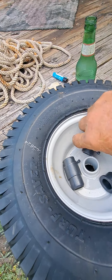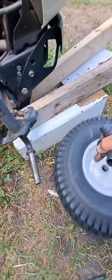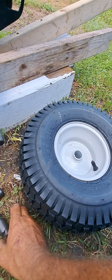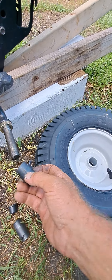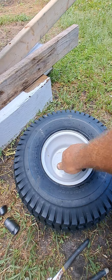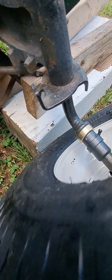Now we go with our spacer. I don't know which one of these is the right insert. Might as well grab the tire while we're at it. First your spacer, and that goes on. I'm pretty sure it's a smaller insert on this one. Always remember to put this thing on the outside — God forbid you get it on the wrong way. Normally you would grease these things, but that's what that tube is right there. That is a grease fitting. They go together easier — they're already greased.